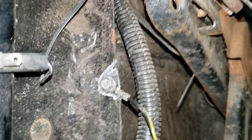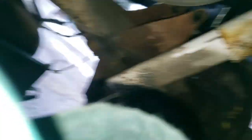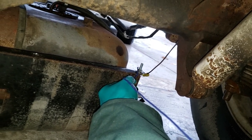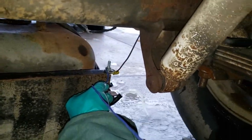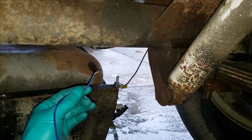That didn't do anything - the fuel pump still doesn't prime. Now we're checking the fuse box; some things are getting power and some aren't. We're about to see if it cranks with the starter relay, and if it does we'll remove the starter relay and see if it cranks again. This white wire here - I attached a blue wire to it and my dad on the other end has it attached to battery. If I touch it... you can hear it and you can see gas coming out there. So that works when you wire directly to a battery. Now we just have to figure out why it doesn't work when it's normally hooked up.